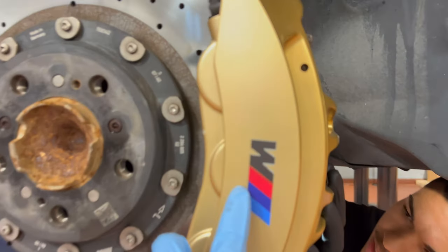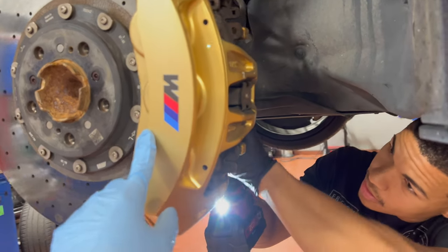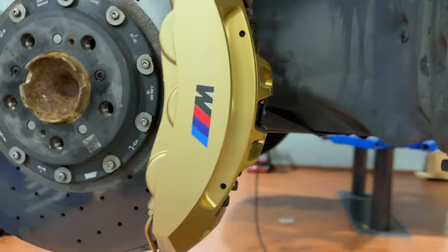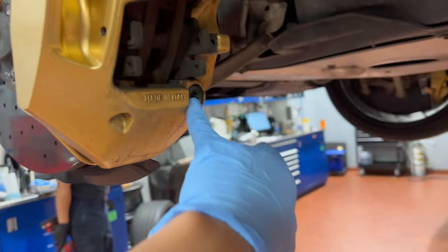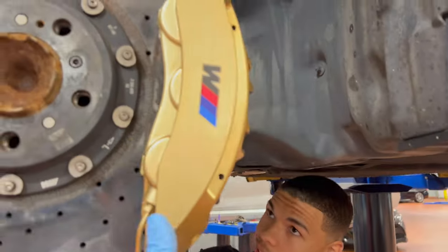Thanks Chris for getting this, of course. And we take out the rear caliper bolts — right one and two. So there's two ways of doing it. Everyone online says to take out the alignment bolts, which are right here, but BMW wants you to do it from here. So we're gonna do it from here per Benny boy.